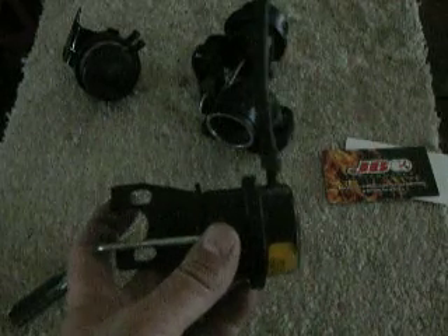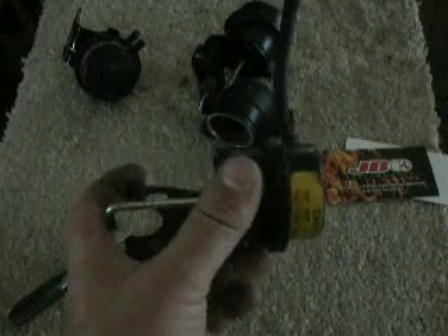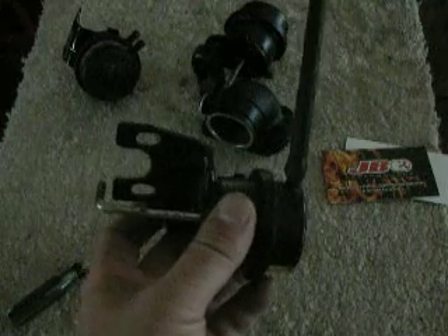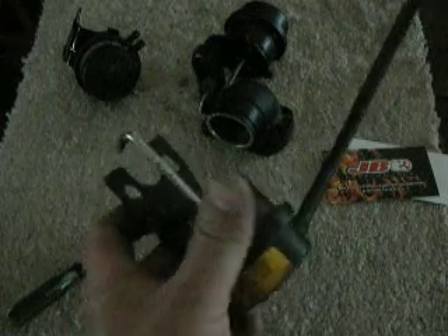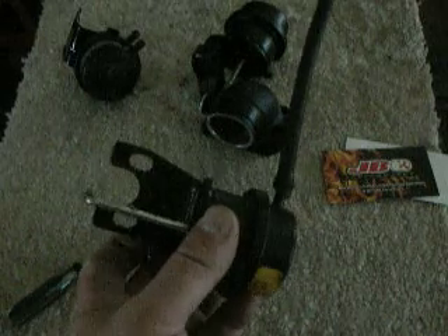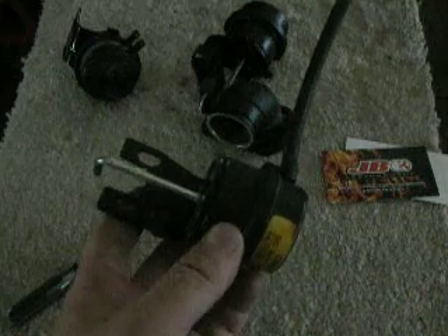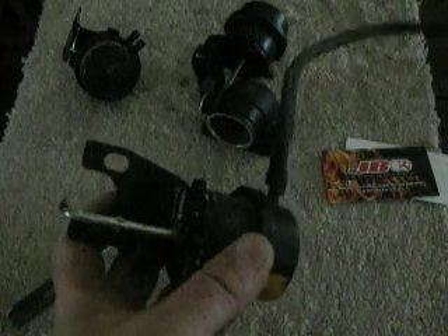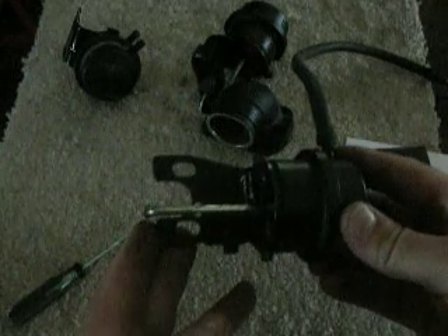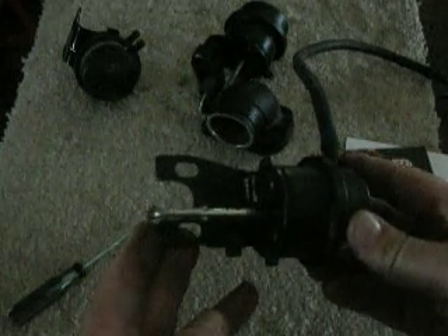You can see that it's important to have one of these devices to physically test the worthwhile value of a bypass valve. This is a good contributing part to failure of superchargers on a car, that's why I felt it was important to talk about it. Many times people don't send their bypass valve in with it — I highly recommend it. We'll test it for free if it's coming in here with a supercharger repair. We'll be carrying various types on our website for replacement.